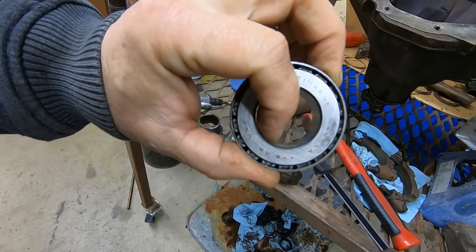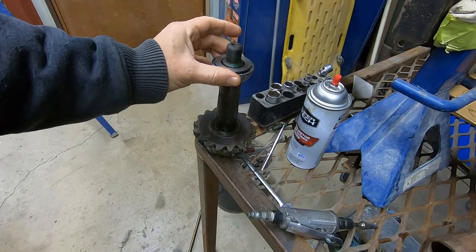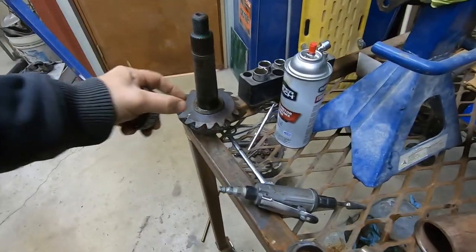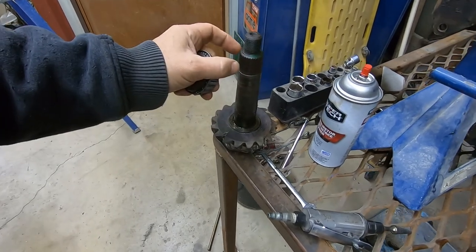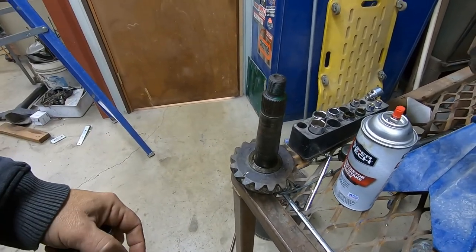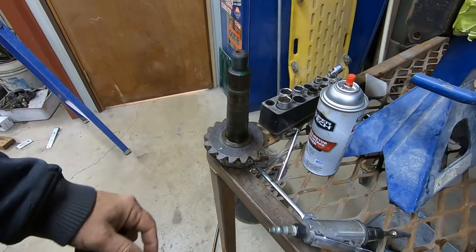Got a brand new bearing, same one you're gonna use in your final setup, and take this inside diameter and open it up so that I can just slip it down onto the pinion and slide it back off. Of course, we'd be talking about the big bearing down at the bottom here. Want to be able to slide that one off. I wasted an upper bearing too, so that I have one there that slips out, because having to drive that pinion out of there every time, if you have to change your setup multiple times, you can damage those threads. And it's just a headache to have to knock stuff on and beat it off every time.